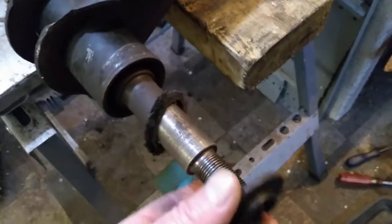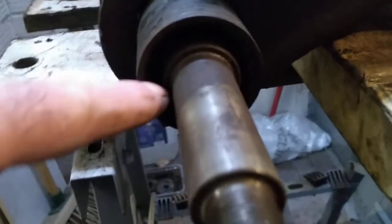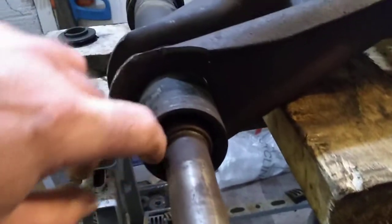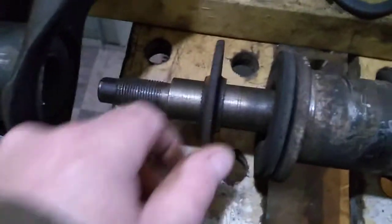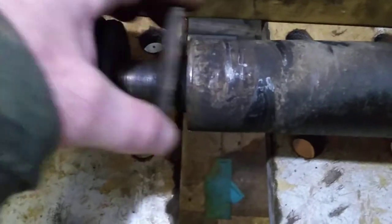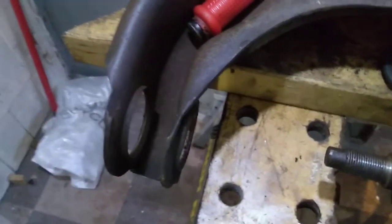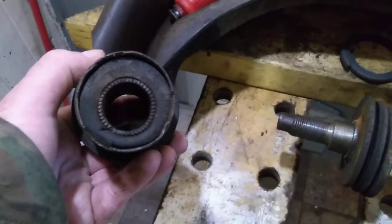Here's the metal washer I told you about, and here's your disintegrated rubber washer. Inside is your rubber mount — you can't see it but it's in there. The whole shaft has rubber all the way around it — hopefully yours is in good condition like mine. On the other end you've got a funny-shaped washer, rubber spacer, and something that locks on. Once you've got the shaft out you can tackle this bushing. I used an extensive ball joint installation and removal kit — I highly recommend one — it took about five minutes and the bushing was collapsed, so it did need changing.